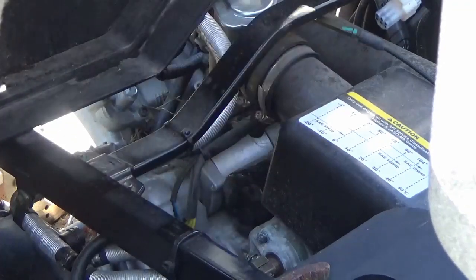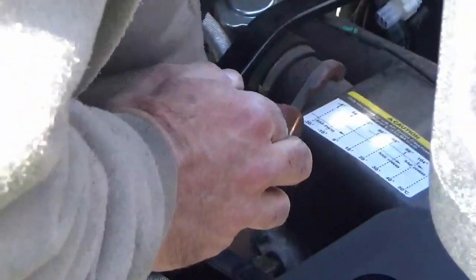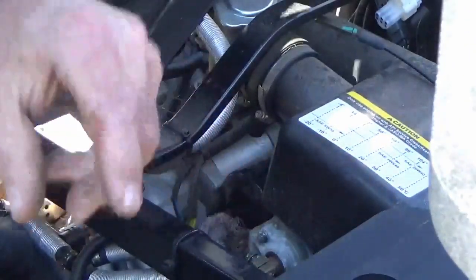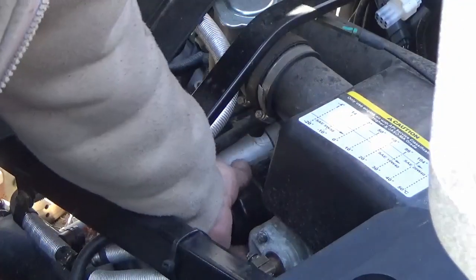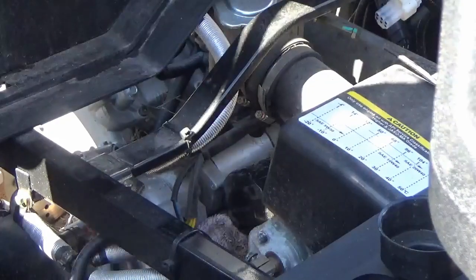There's no getting that expansion tool in there, so what I really didn't want to do was use this oil filter last-resort wrench. I should mention I have a rag down here to catch the oil that's bound to spill out of the filter, just to prevent most of it from running down the side of the block. There's no getting that in there either. As a last resort, I'm going to try and bang this other cup over the oil filter using a persuading tool.